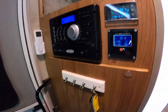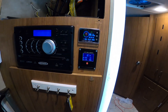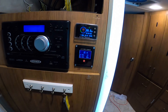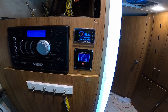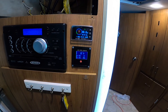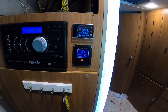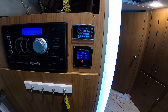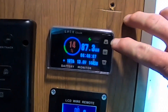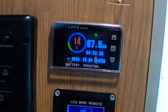The battery is supposed to come 30 to 50 percent charged. It's been on here for a couple of hours — I'm just on the 30-amp setting from the 45-amp converter, running like 30-35 amps. I clicked the second converter on just a second ago before I started the car — it jumped up to 60 amps, so that's another 30 with it. That worked good. I want to turn the inverter off so we're not pulling that load, pull up in the sun to get some solar going, plug it back in, and get her charged up to 100. Hold this button down and it'll change the setting so you can monitor your battery — it's already added 87 amp-hours in a couple of hours off just the converter.